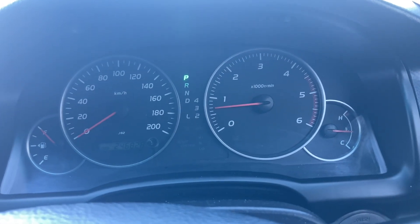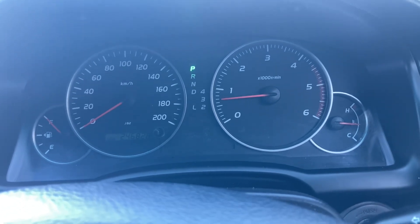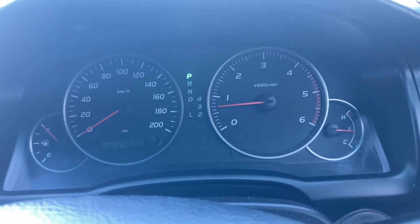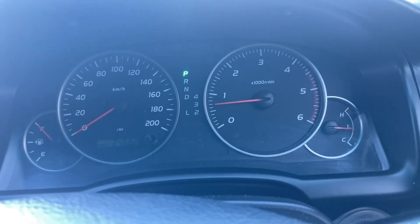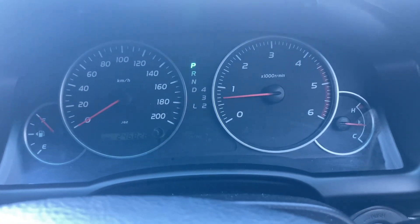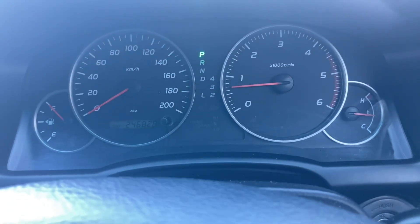I'm not going to go into the best way to warm up your engine in depth - I've got videos on that, just search our channel: best way to warm up your petrol, best way to warm up your diesel, best way to warm up your hybrid. The quick version: it's not sitting there letting it idle. In cold weather like six degrees, it is going to take forever to get up to operating temperature - you're just wasting fuel and contaminating your oil.